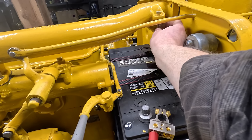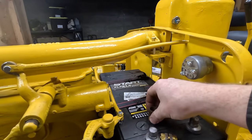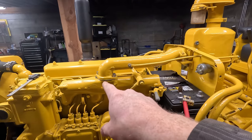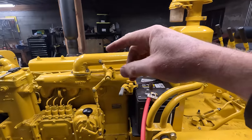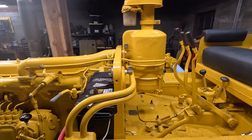They had a 1/4 inch bolt, and then they had this running at an angle to kind of pick up the slop. It's really not a good system. This might be a surprise, but this air cleaner weighs a ton. It's sitting right there, and the only bolt spots are right there. So if this thing's jiggling around, that's a lot of torque right there. It's gonna end up breaking these ears off. And that's probably why it was rubbing on these pipes.